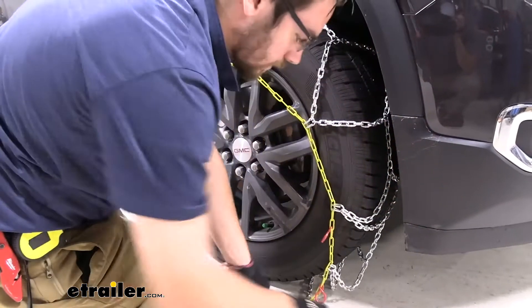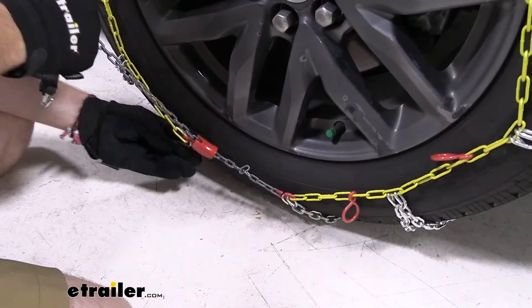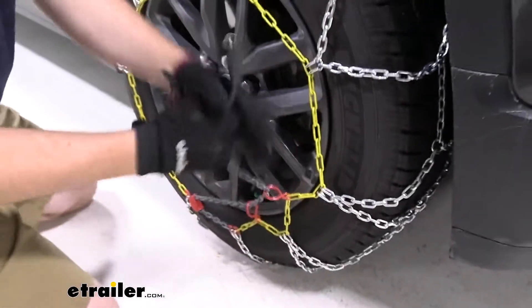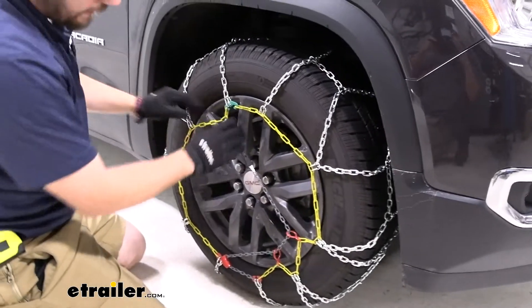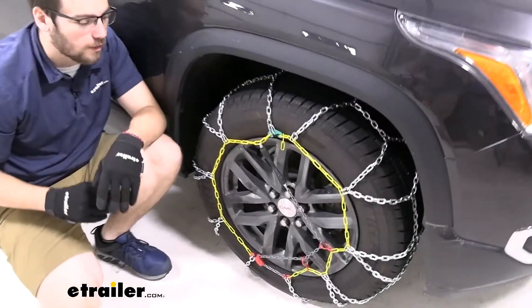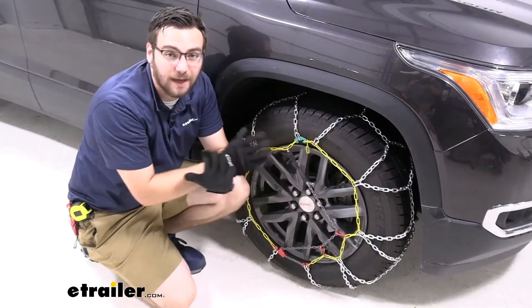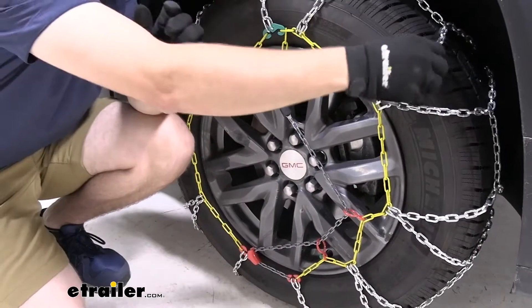I went ahead and got myself caught — just jiggled it out a little bit. This is our tensioner here. We're going to take this right around our little red choker, pulling it nice and tight. We can actually loop it through the ends and then pull it across and into the other side of our chain. I wasn't liking how much it was making contact with my rim, so I went ahead and reseated it all. As you can see, it's fitting a lot better. The big thing we did was put it to that third link. Those ends will dangle a bit but won't cause any real issues. If you're worried about them making contact with your rim, you could go ahead and snip those. That self-tensioner does a great job keeping everything nice and concise across the entirety of our wheel.